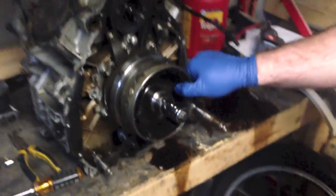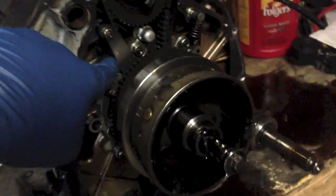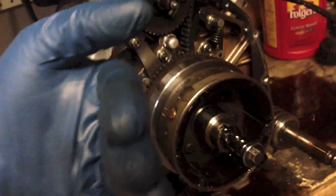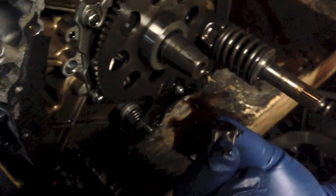Now for those who are doing this, that it's racked their brains as much as it did mine: I had an impact wrench set to tighten. Whenever I tightened this bolt, the threads were long enough that it pushed against the crankshaft and pushed the flywheel out — and that's the goal. Something fell out there, not entirely sure what. Anyhow, this thing isn't threaded on at all, it just kind of sits on it, and that's how you get a flywheel off for a CX500.